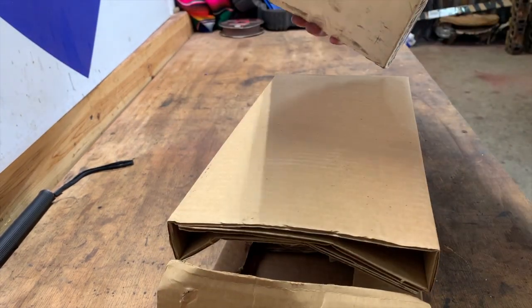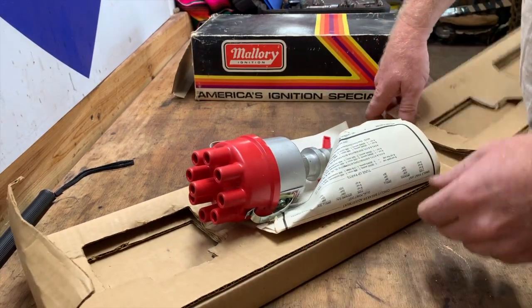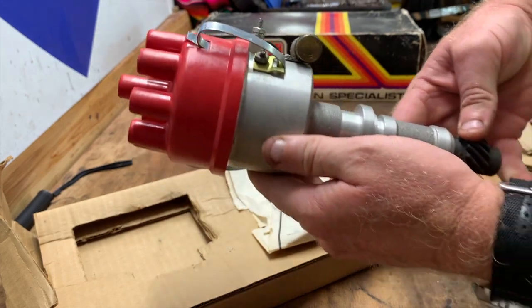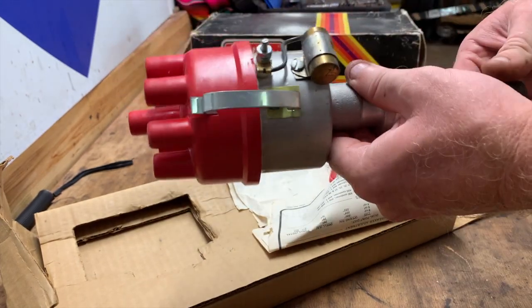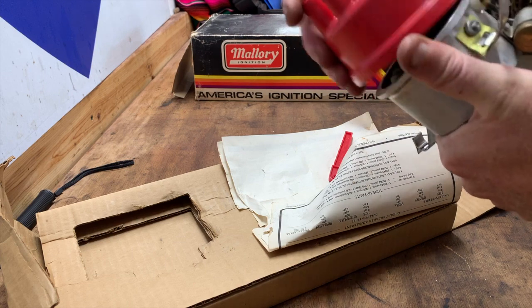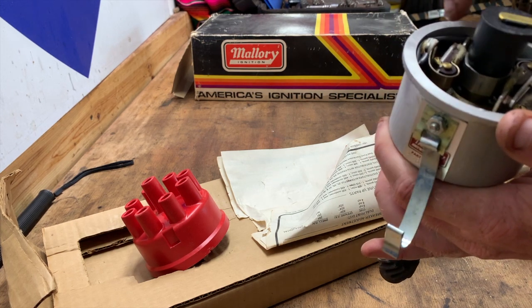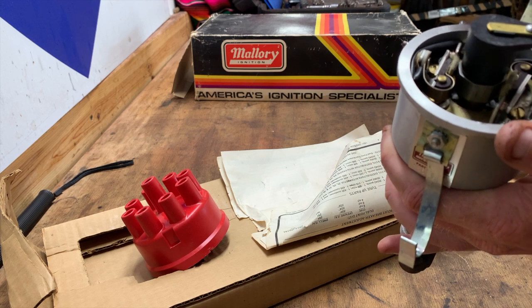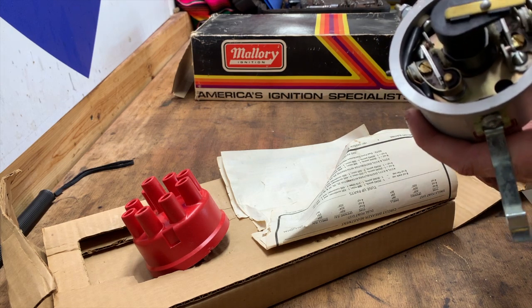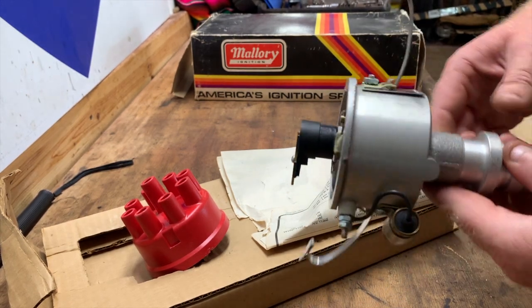Just a basic looking box, but it does look pretty cool — very seventies. Here is our distributor. It has never been run; it is literally brand new looking. It's even missing the O-ring down here. Now it does seem to turn fairly easily, and of course everything looks brand new inside. This was the stuff that my other distributor was missing — these screws that help you adjust the points. This has a brand new set of points in it, the rubbing blocks are going to be brand new, and the felts are going to be new. I'm going to need to put some grease on it before I do anything, but this is what your Mallory dual point would have looked like brand new.